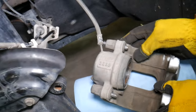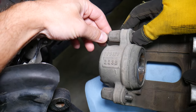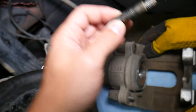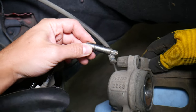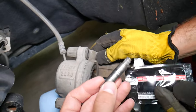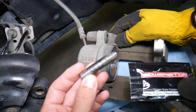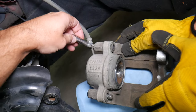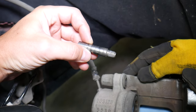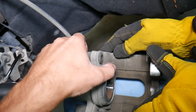What else can cause brakes to overheat? You have two caliper guide slides right here that allow the caliper to move left and right to center itself. If those guides are really rusted, really dry, and not greased up correctly, that will cause problems as well. We'll have a video on the channel explaining where to apply brake grease and how to do that. In some cases you even need to replace the guides because they can get corroded and completely destroyed.